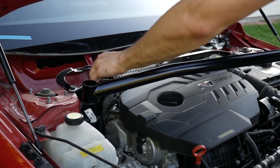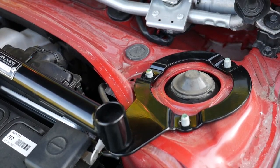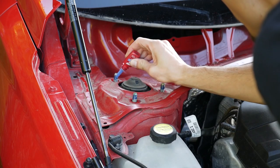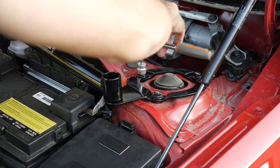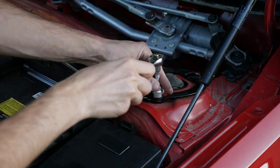Now is the time to fit our stud into place, and it falls in as it should. If you concentrate on the very details of the screws, you would notice they kind of protrude. You can see there was a thread locker applied, so I'm here to apply it again in a liquid form. This is one of the things you definitely want to do, so that you avoid any vibrations or unwanted noise, which is highly likely to come from this area.